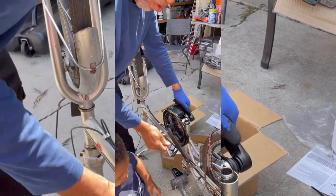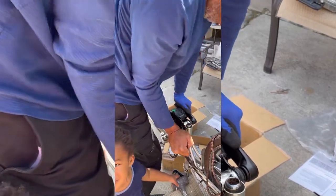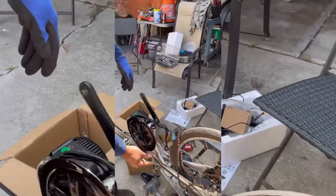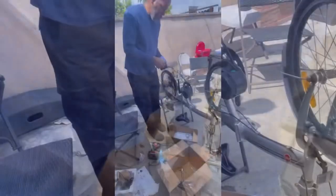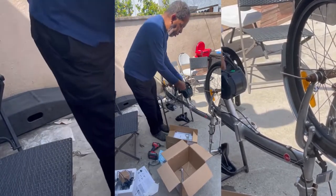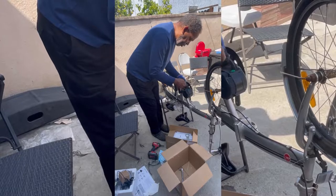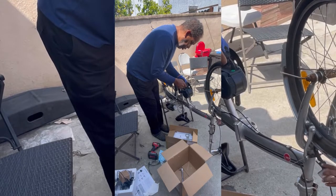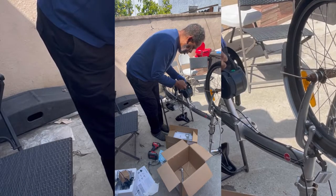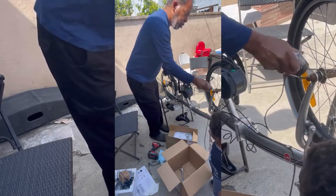Of course, you take the pedals off the other bike. I mean, off the old thing, because it don't come with the pedal. There. Now, this is literally hooked up. That's a beauty. Oh no, these. Oh, it's this one. So these plug up to this one for the light. So that's for the front light? For front light. And it doesn't matter what location. Just stick them in. This is for your headlight. Make sure it's pushed in. You hear a little snap. In some cases. Yep. And we just leave it here right now.